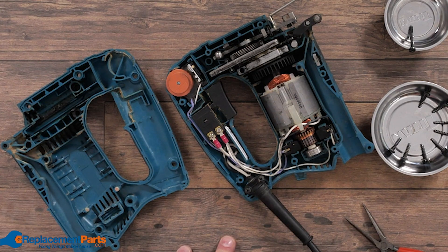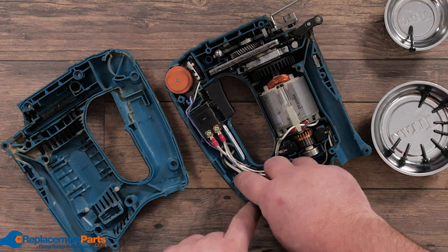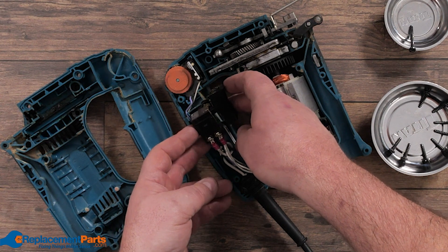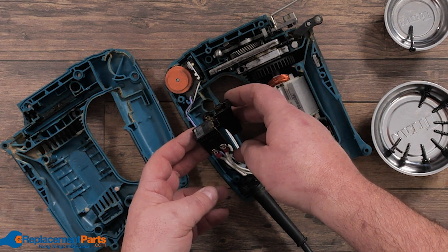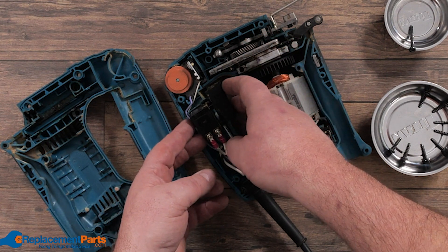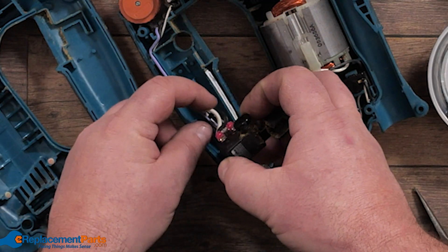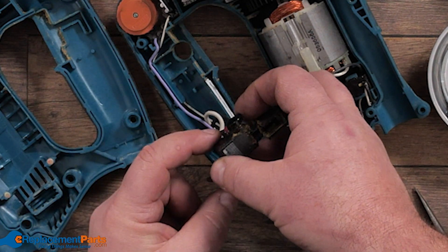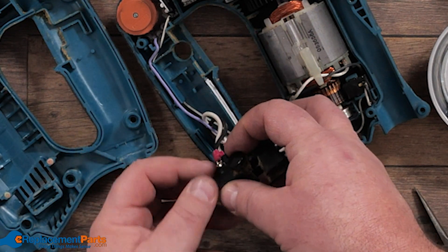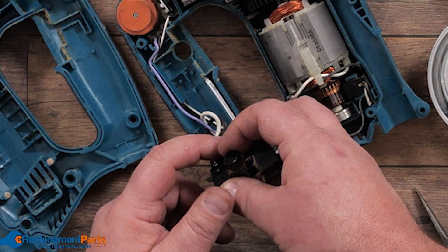We're looking at the switch to see whether it's broken and needs to be replaced. To do that we follow the main cord — you can notice there's a white heavy gauge and a black heavy gauge going to the switch. We'll pull the switch up gently, trying not to bend the wires too much, because keeping them in their natural bend means they'll automatically go back to where they want to be. Lifting it up I can see the white wire from below and the black coming up, so that's my power coming across to the other side.